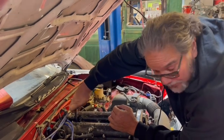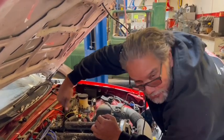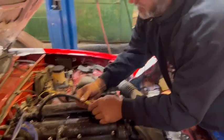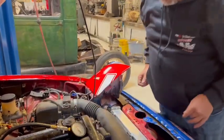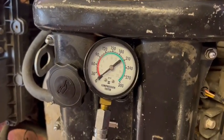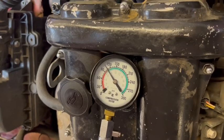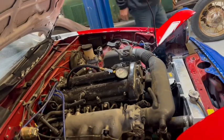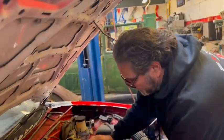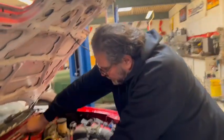One of my subscribers was driving this car when it overheated - it really wasn't his fault, but I'd like to blame him if possible. You know who you are. Last cylinder - we've got about 100. So one cylinder is working, which is still a little low. I say anything under 150 I consider bad.